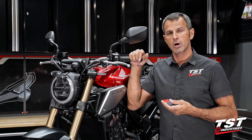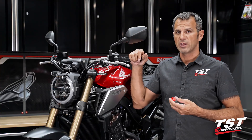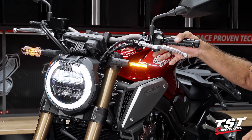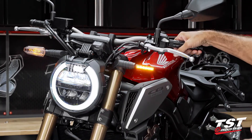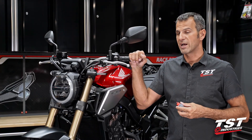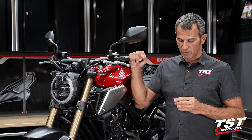The OEM signals are LED type signals, so you would think these bikes will flash just right with aftermarket LED signals — but that is not the case. This system is designed with a certain threshold of current draw in mind. If it falls below that, like it does with aftermarket signals, it tries to alert you that something is not up to spec. Typically you want your signals to be flashing, and the OEM signal relay is prohibitive of that.